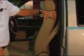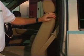Well, starting with the driver's seat. We've got an all-new driver's seat and front passenger seat in these vehicles, and we did this for a couple of reasons. We did what we call a thin profile, low mass seat, and you'll notice here how thin this profile is. It's actually an industry first. It's an aluminum structure. We saved about 20 pounds for the entire vehicle just by executing these seats alone. They are all leather. They're heated front seats. They're six-way power adjuster, manual lumbar. So now let's get in and see what else we have on the inside.